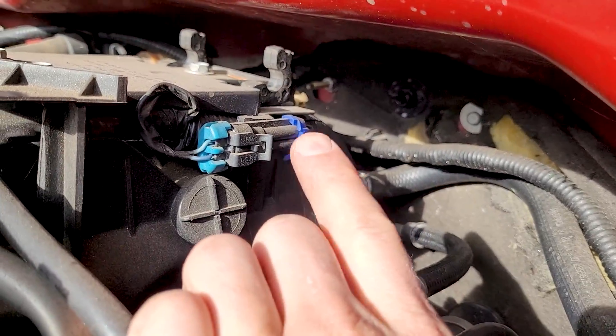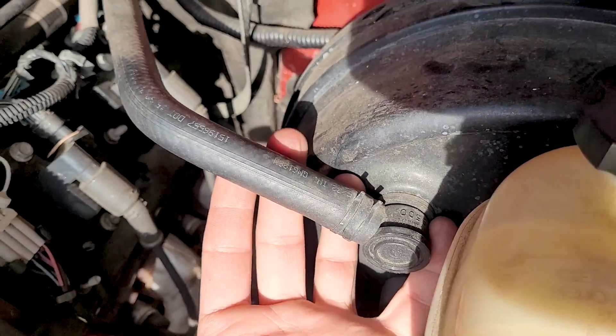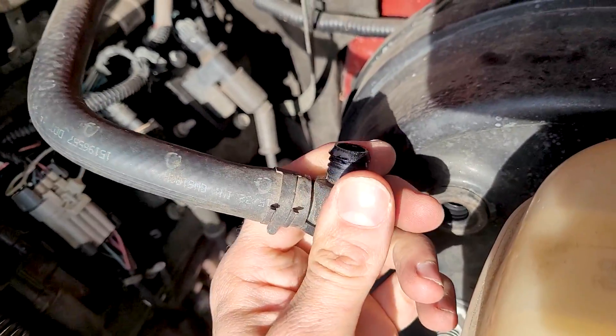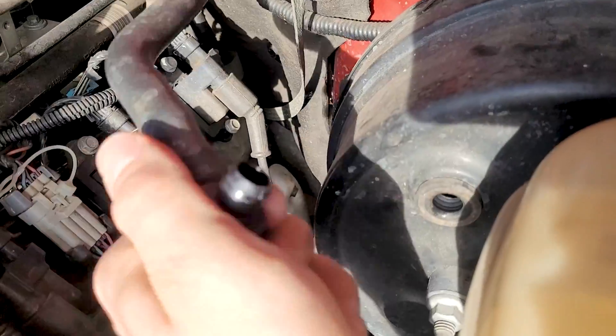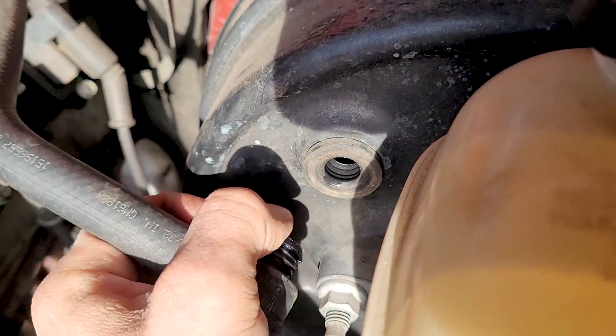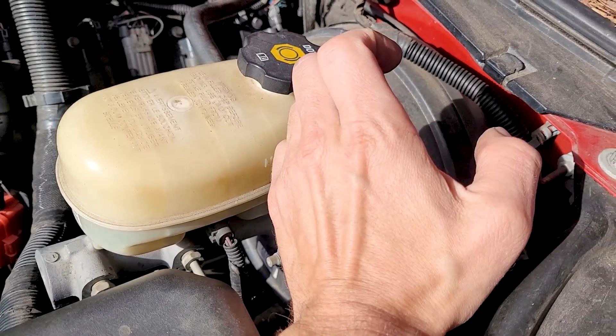On the back right here, you have a tube that comes over to your brake booster. This is a check valve — these can go bad. You've got a grommet right here that can leak, and inside is the brake booster with a big rubber diaphragm. These can go bad and suck a huge vacuum, causing a ton of performance issues and running problems with these trucks. It's a rare problem, but it can happen.